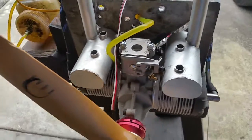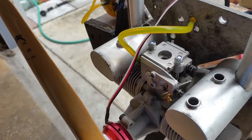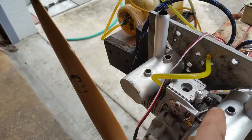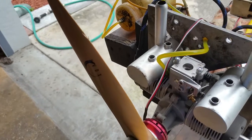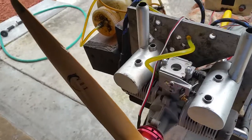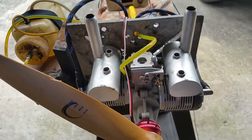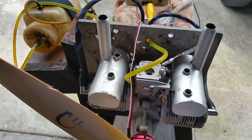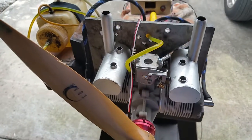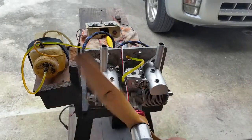One thing I don't like about this is the position of the needles and idle — the muffler is right here in the way, so it's really hard to adjust. Also, pay really close attention to the prop when it's running because it's really easy to put your finger into it. It idles around 1,500–1,600 RPM. The prop is a CZ 17×6 and it goes up to 8,000 RPMs.